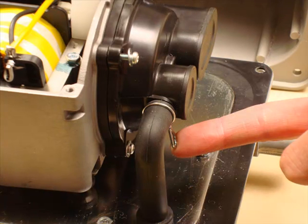Another tip here: slide the clip around so it points downwards. It may not seem like a big thing but it will keep the clip well away from the external casing, avoiding it buzzing against the casing when the pump is completely reassembled and started back up.